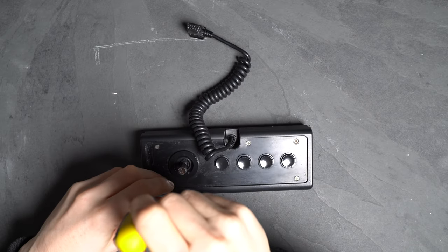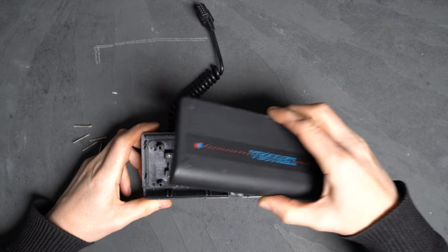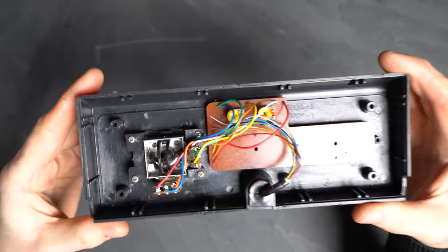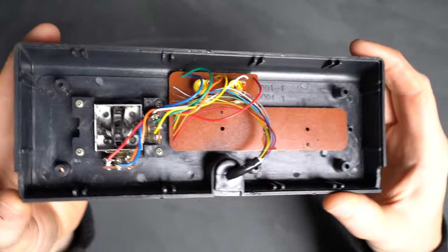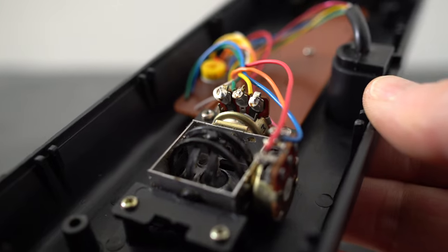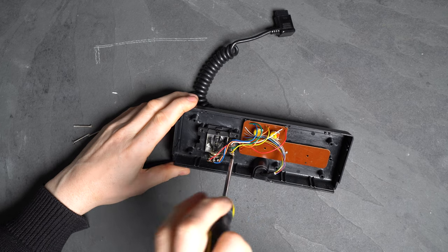With the sticker peeled off, you can remove the five Phillips screws from the top of the controller and separate the two halves. Inside the upper section, you'll see the back of the circuit board for the buttons and the joystick held in a plastic cage, itself held in place by four more Phillips screws that should be removed for easier access. Each axis of the joystick turns the potentiometer back and forth, while a spring on the inside returns it to a central position. You may be able to just see the two legs from one of the springs poking out, while on the damaged axis there's no evidence of any spring.